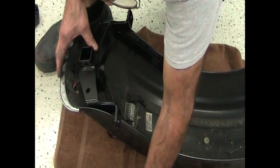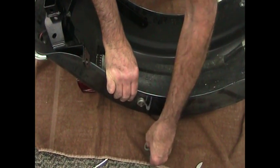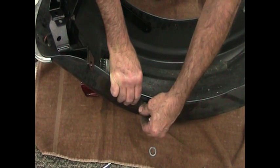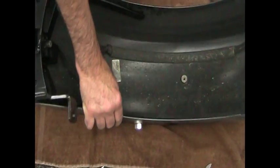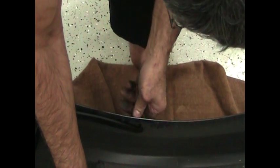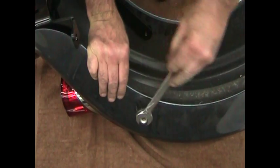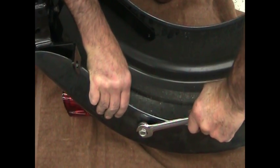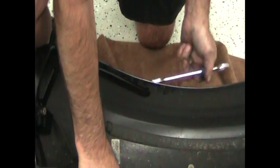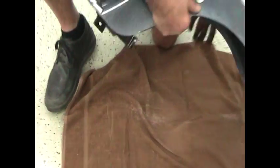We're going to put the two nuts and washers back on. You notice it wasn't super tight when you took that apart, so we're not going to over-tighten these — if you over-tighten them you stand a chance of breaking that hollow-threaded stud off. About five to ten foot-pounds of torque is all you need on that — really just snug. The other bolt that goes through the center holds that to the frame. Your hitch is on, and your fender is ready to go back into the bike.